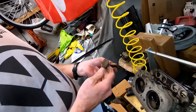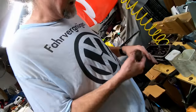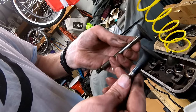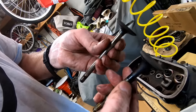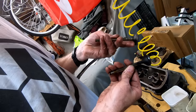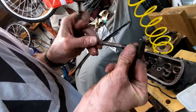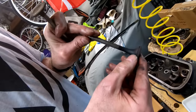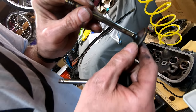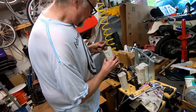So here there's intake for number one. Here we have an exhaust valve — the smaller one — and the intake valve — the larger one. When you take them out, you'll notice I have not cleaned these yet. The intake in my left hand is much cleaner all the way down, and the exhaust is quite dirty — that's because of the burnt gas, air, and additional carbon. We're going to clean this up on the grinder. You can see the shiny part where the valve hits the seat — that's what we're going to be grinding to match the valve seats. So let's take these out to the grinder and get to it.